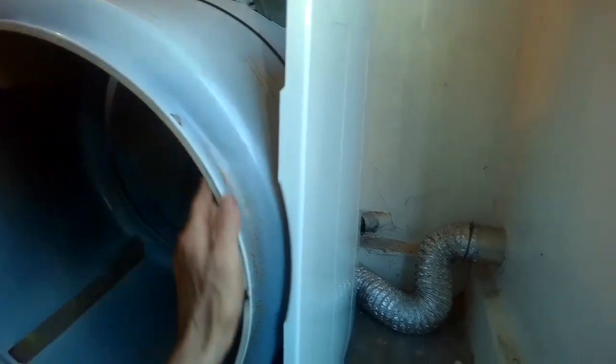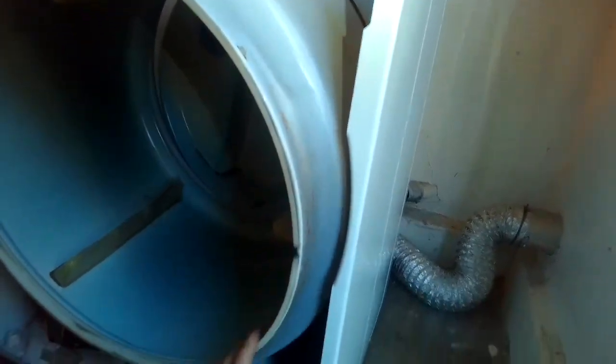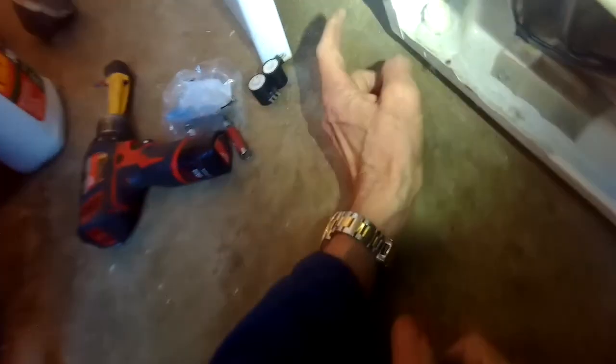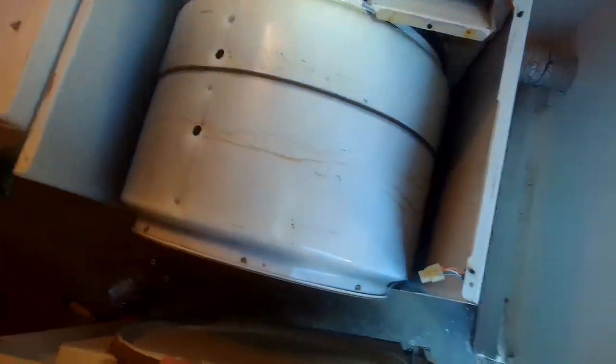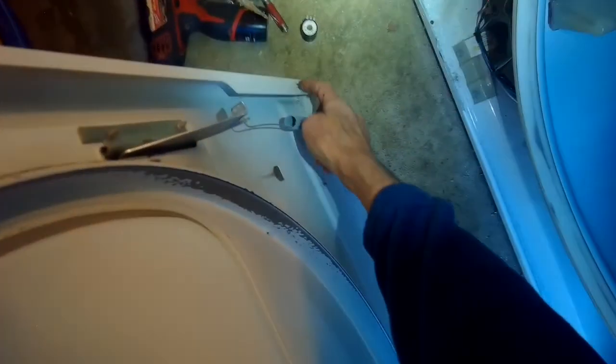It's laying on a couple of wheels in the back, one there and one up here in the corner. And what holds it up in the front is this plastic thing called the bearing, and then there's the front panel. The bearing surface is felt, holds it up, and the panel sits down into these little forks, so you have to kind of lift the panel up over and let it sit down. So that's the next step. There's a hole here and a hole here, and it's going to sit on those forks.